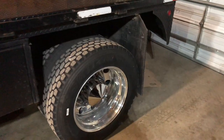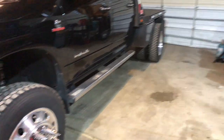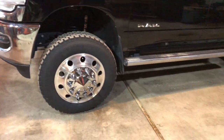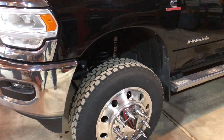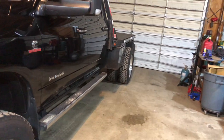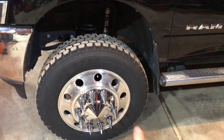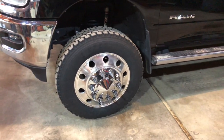The stock rims are hub-centric, just like these semi truck wheels are for the most part. You do not have to get notched-out rims. If you had a 4500 or 5500, you would have to get notched-out rims, or get a 2-inch thick spacer and sometimes modify — you'd have to cut the heads off of the studs so they will bolt down, or notch out the inside area around the hub so your lug nuts can feed through.